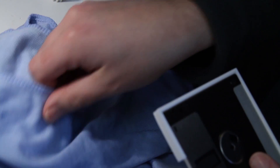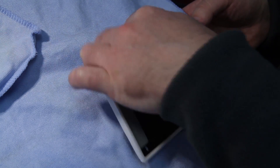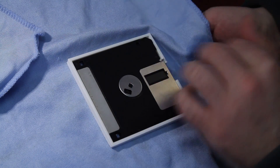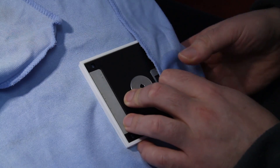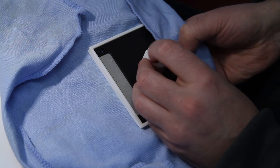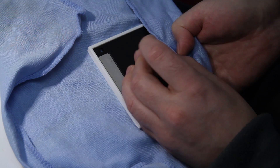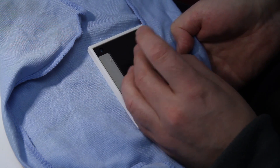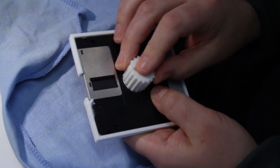The disk surface is actually quite tough — you can't damage it like that with a cloth. If you apply equal pressure with both fingers on the disk surface, don't push down, but just pinch equally hard on both sides, then there's no problem. Don't squeeze too hard, because the hub can come loose from the disk donut — the metal thing. That may not be a good thing; you'd have to glue it in place and that gives a lot of other problems. So don't squeeze too hard.